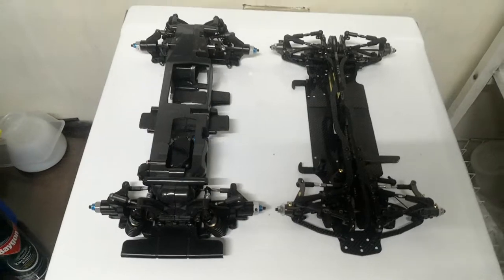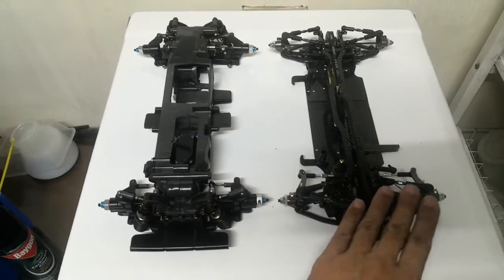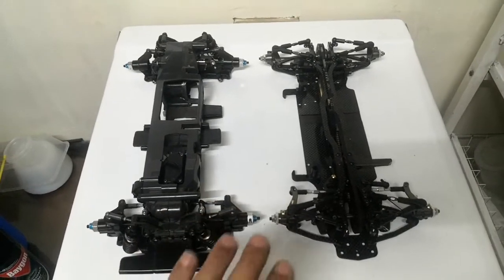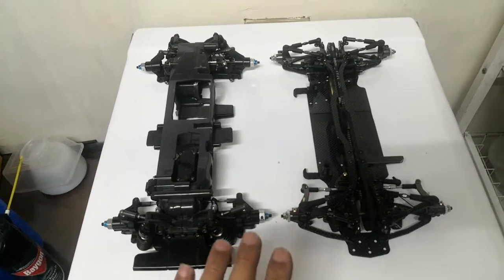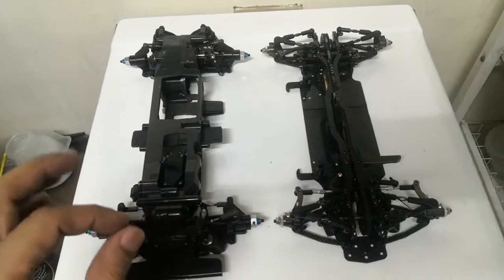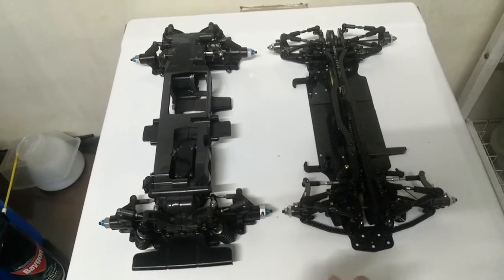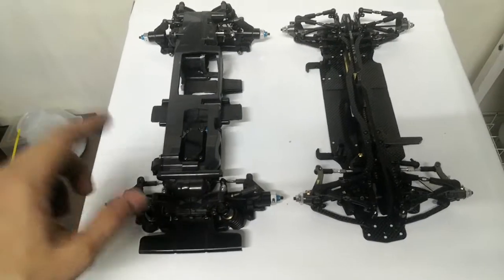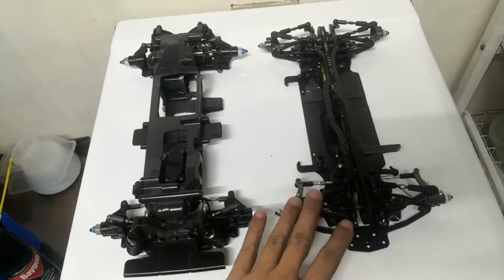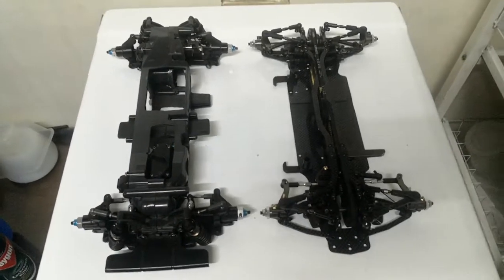Okay, so what's the difference? Well, the biggest thing I could see is the center of gravity. The newer designs are always lower and lower. That helps the handling, especially in high grip. When you do left-right transitions, a lower center of gravity makes the car more stable. But on very low grip, slippery tracks, I think low CG will not give enough grip compared to a high CG car. So in very low grip conditions, this car might come close to the speed of a new car. Yeah, wishful thinking.